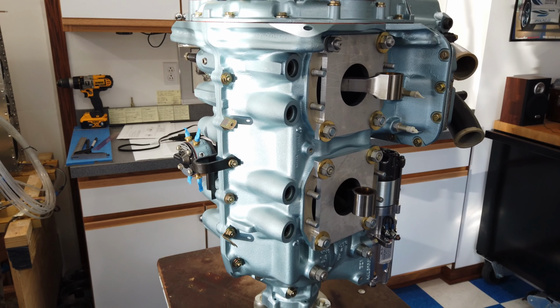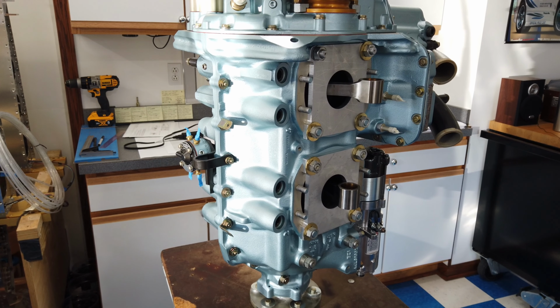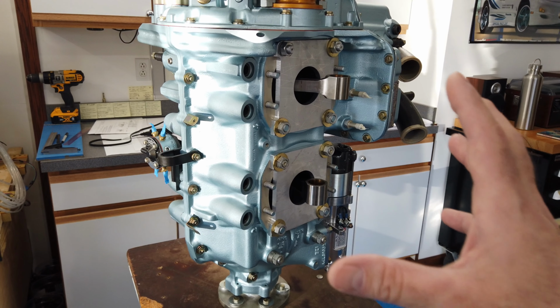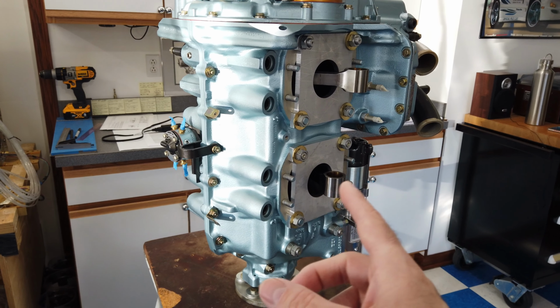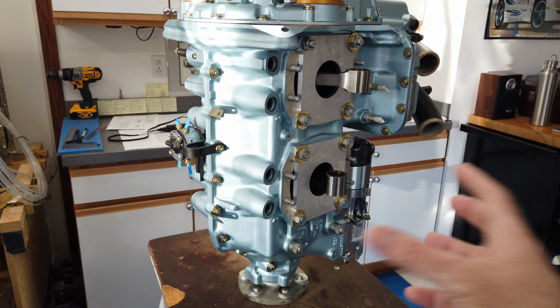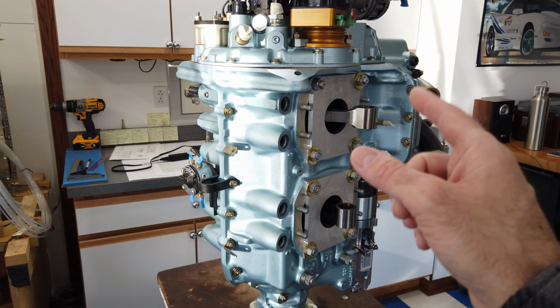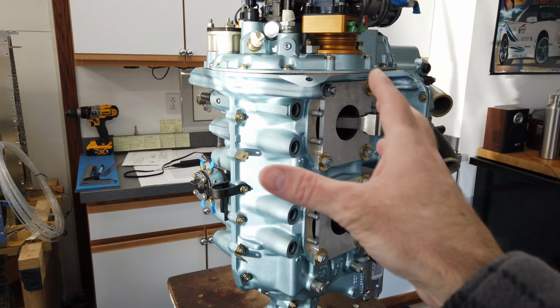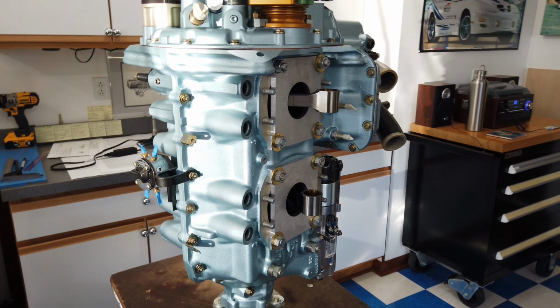And if you think about cylinder replacements done on actual mounted engines in aircraft, they don't unbolt all 4 cylinders just to replace the one. They leave everything, or they should leave everything that they can, torqued and just work on this single cylinder. So that's kind of my plan of attack. I'm only going to pull off torque plates as I need to install the cylinder. Then I'm immediately going to torque those cylinders before I remove the other torque plates. That's basically the bottom line. So I think I'll do that next.